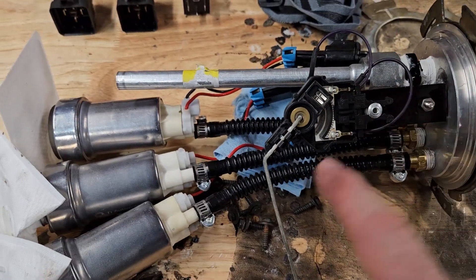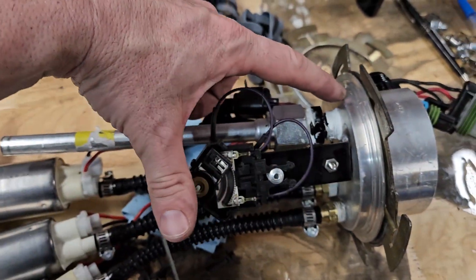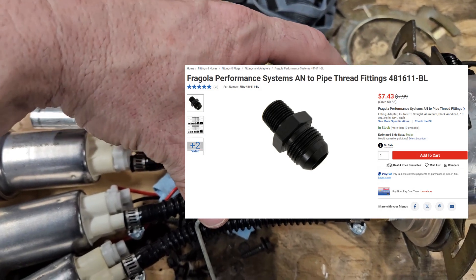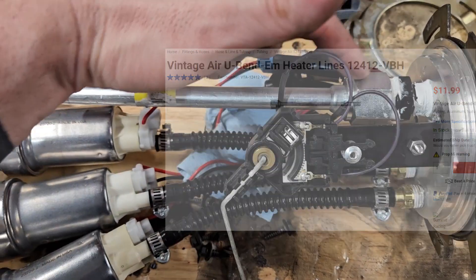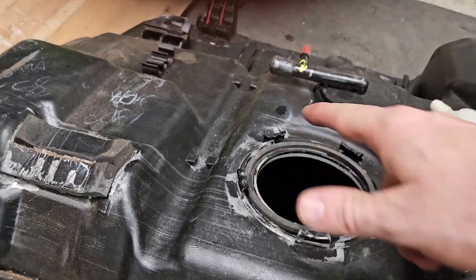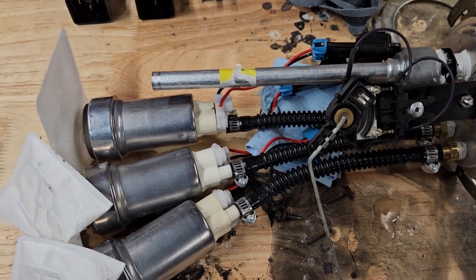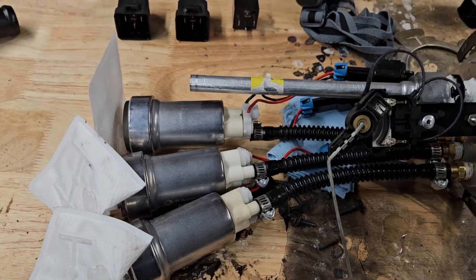The kit had wiring and some other stuff, but I didn't touch the wiring — just the hoses and the filters. The return was all the way up here and just ended, with fuel waterfalling down into the tank. The waterfall causes aeration, so I picked up a 3/8 MPT to dash 10 fitting. This is actually air conditioning hose — 10 AN — 12 inches long and I cut it. Measured from the level down at 10 inches, put my square there, measured up 9, so there should be 1 inch between the bottom of this and the bottom of the tank. The things that kill pumps: aeration, bad wiring, and restriction — both on the pressure side and on the vent side.